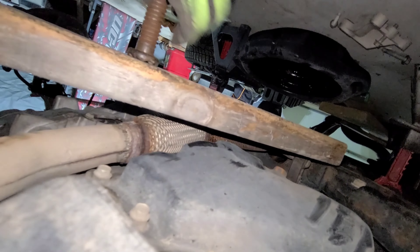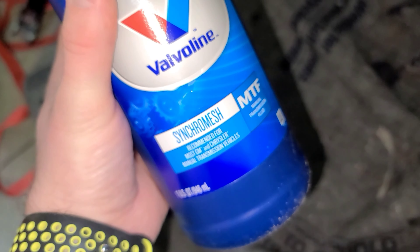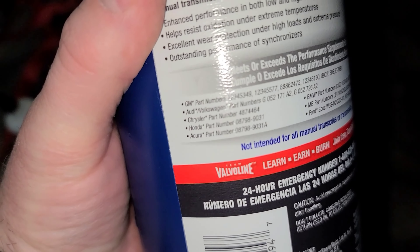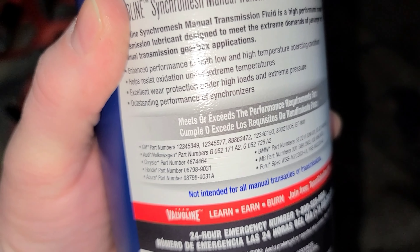We're going to go ahead and start putting some stuff in down here and show you progress when we're done. Welcome back guys — so transmission fluid. I couldn't really find it because it's a GM part number, and dealerships are closed on Sundays and Saturdays too, so I found an alternative. It's the old school Synchromesh — there are two part numbers: 5349 and 472 that the Spark takes.